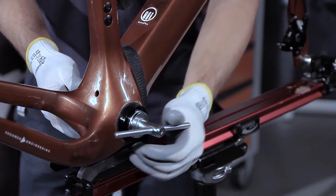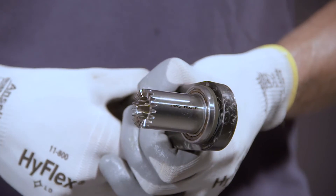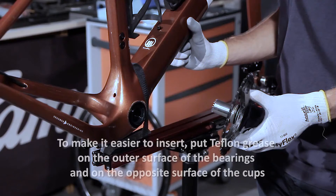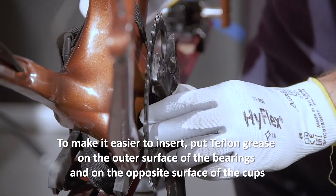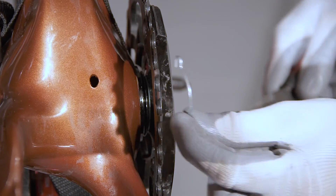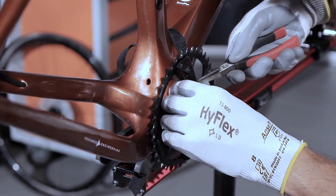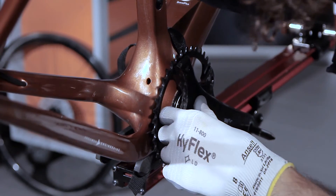The new PROTEC sealing system makes the coupling between the bearings and the bottom bracket cups very precise, and as such, we have a few suggestions. Only install the right-hand crank in the respective bottom bracket cup. If this proves difficult, you can gently tap the crank, either using your hand or a rubber mallet. Fit the right-hand safety clip on the respective bottom bracket cup and check that the right-hand crank is properly locked in place.